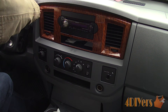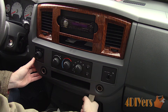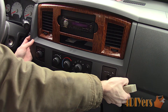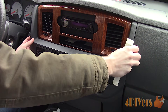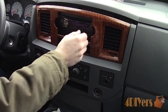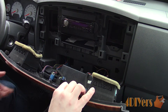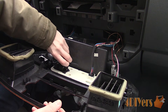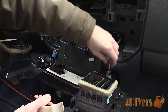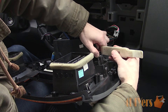In order to install mine, the radio bezel does need to be removed. With this particular truck there are 2 screws just above the cup holder, however mine were missing. Next, use a nylon trim tool to disconnect the clips holding on the trim piece. With it currently being cold outside, be careful with the plastic as it can be brittle. Once removed, tilt down the top — there will be various wires in behind that need to be disconnected. Start with one side and work your way across, as each connector will have a tab that needs to be depressed then removed.